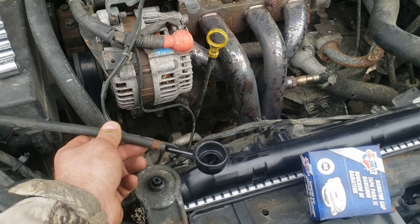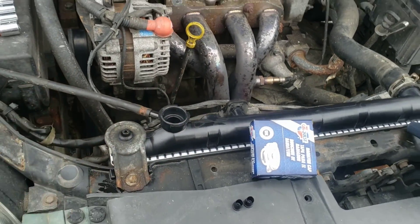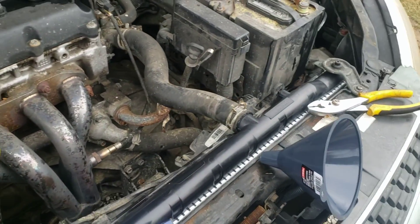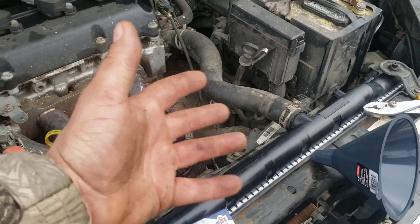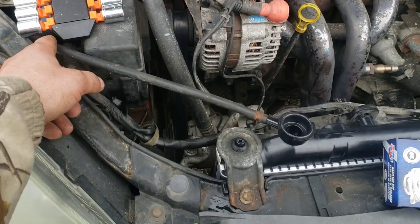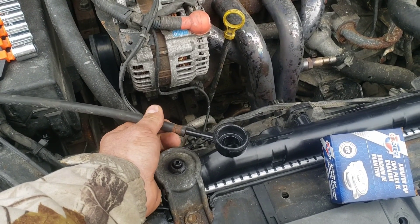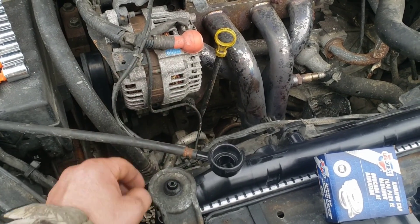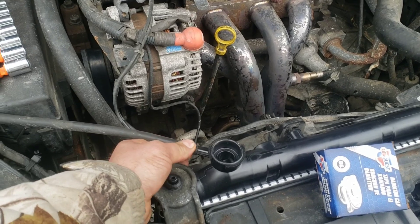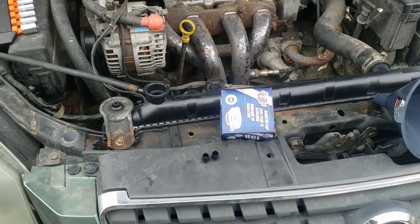This I'm going to have to replace. This is not such a big deal because it's at the top, but this is a pressurized system. So if you have a busted clamp, you definitely want to replace it because you don't want a leak, or God forbid it shoot the line off. But since this is just an overflow return, it should be fine. I might even zip tie it for now — two zip ties to make sure that doesn't come off. But I'm going to need to replace that. We're ready to add coolant now.